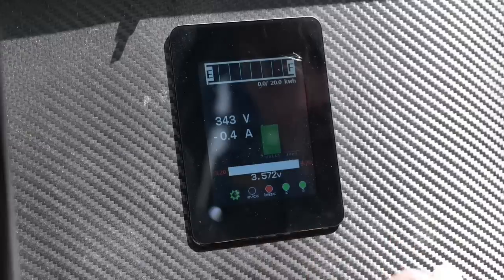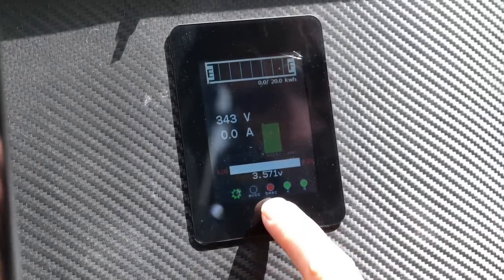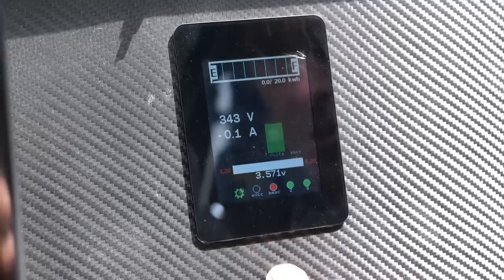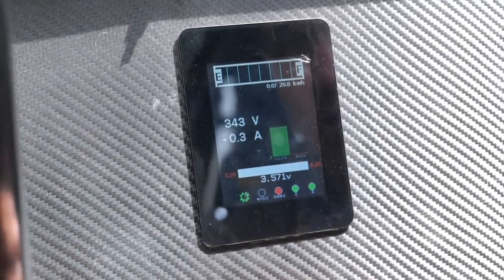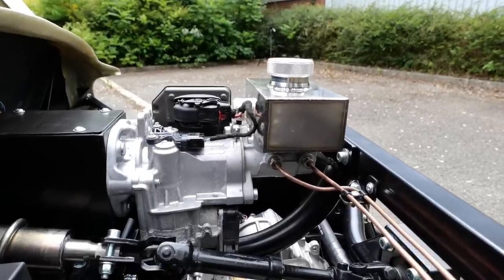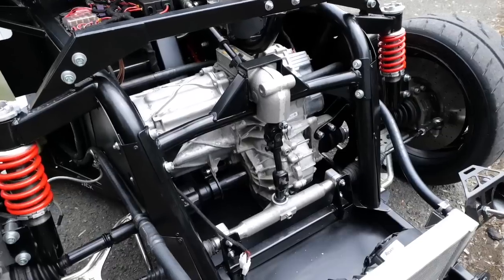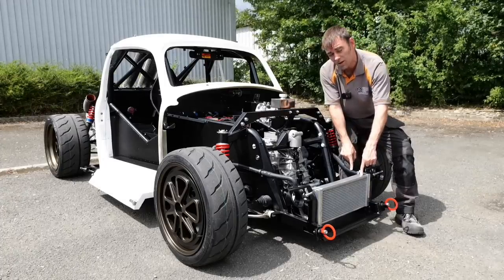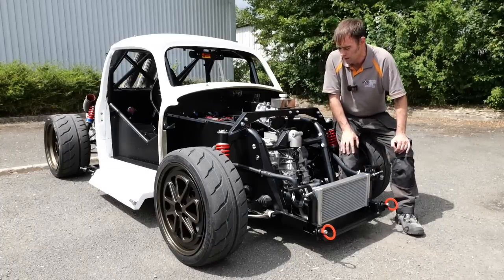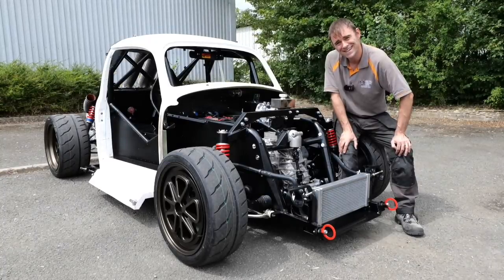You've got your amps — that'll go up and down whether you're flooring the throttle or it's gone into regen. Pack one is showing red at the moment — that's a known issue that developed recently which we've got to fix. That's the BMS display; it's more for information purposes than anything else. Around at the front we've got the front motor in, and the iBooster — the electric power assisted brake system out of a Tesla. All the low voltage wiring is done behind the dash, we've got the bevel box for the steering, and you can see the battery radiator system — the coolant system for the batteries. Whether that's big enough we won't know until we get on track, but it can go bigger if needed.